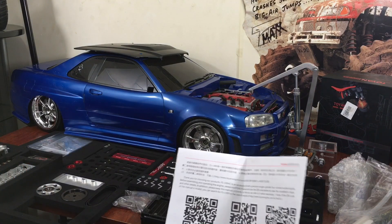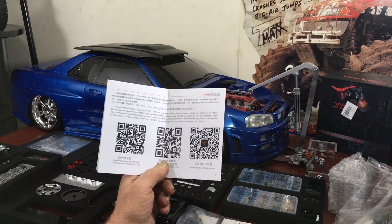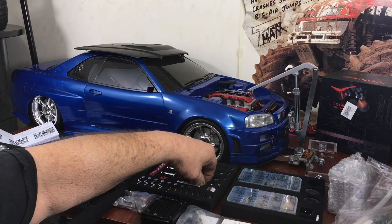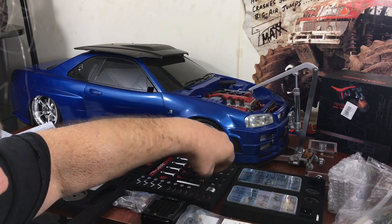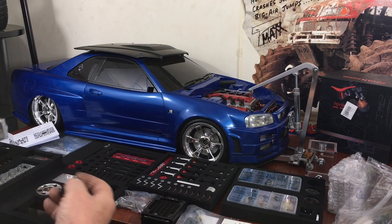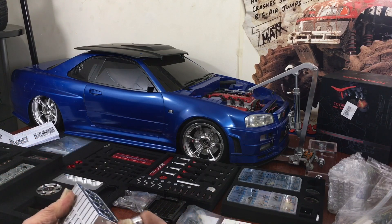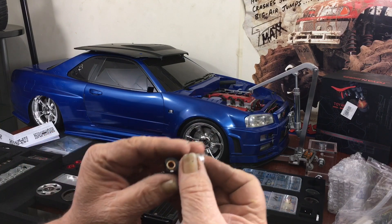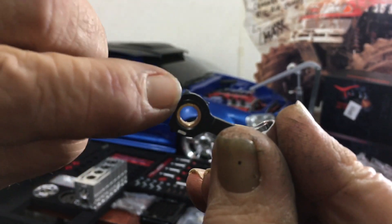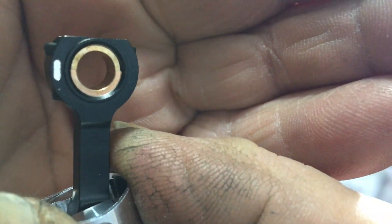One thing I want to stress: when you get an engine, go online and follow the Toyan directions. There are a lot of little things they don't show in the schematic. For instance, everybody knows the rings are not on the pistons — they're in the block itself. You have to keep the rings in that cylinder. There's a little tiny spot on the rod, and when it separates, watch that you don't lose the other half of the bearing.